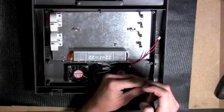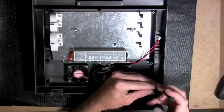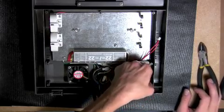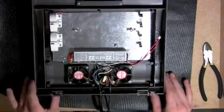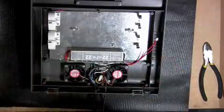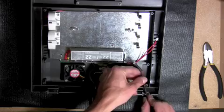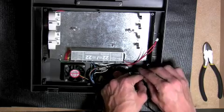Using a pair of wire cutters or a similar tool, cut a notch that measures 1/8 inch by 1/8 inch somewhere in the back wall of the canopy. Next, insert the NVM fix adapter cable into the notch previously created, with the 2-pin connection on the inside of the canopy.